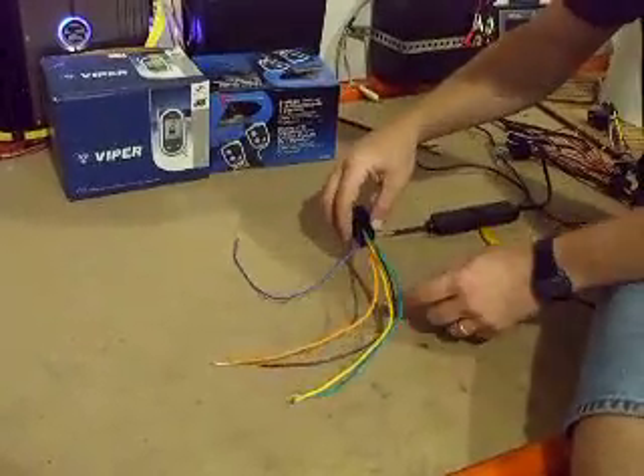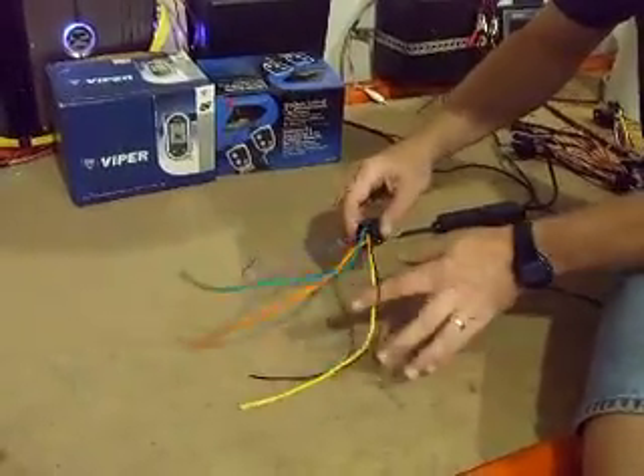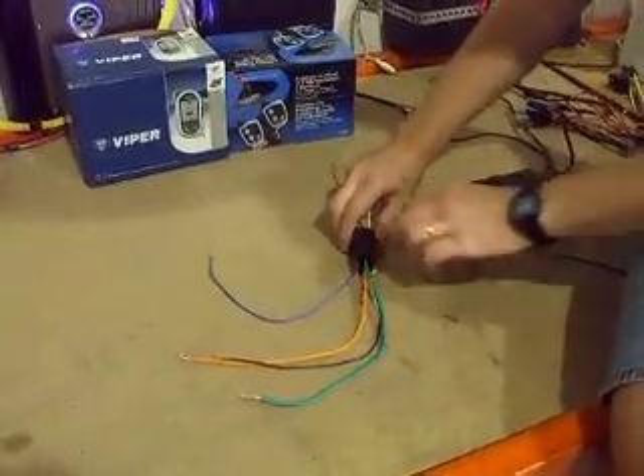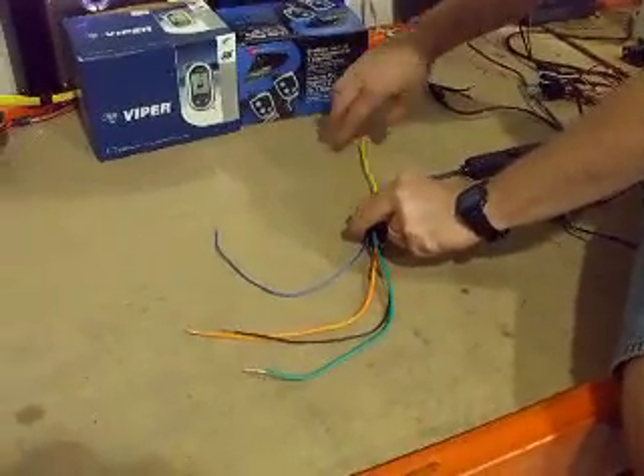In this video, we do not need 87A, which is the middle pin of your relay. Just get rid of it — you can cut it, you can yank it out of the socket. If you're not using a socket, just omit it entirely.